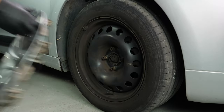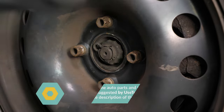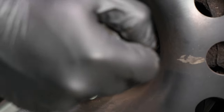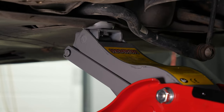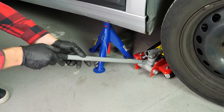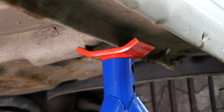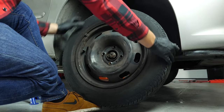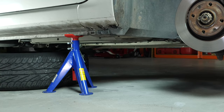In order to change the brake discs and brake pads on your vehicle, you will have to raise the front of your car and take off the wheels. This will provide you with full access to the brake pads. Raise the front of the vehicle and put it on two axle stands. We strongly suggest watching the tutorial on raising your vehicle safely before carrying out this step. You will then be able to take off the wheels. Don't forget to slide them under the vehicle.